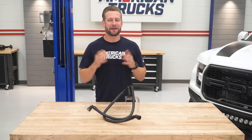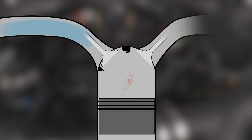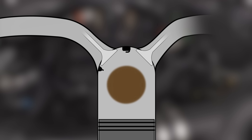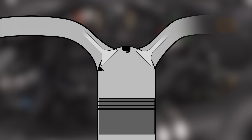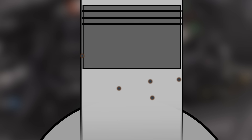First up, let's talk blow-by. This is the result of the combustion event that drives the piston in any internal combustion engine. You've got your gas and your air, which are ignited by your spark plug — they go boom. Most of the remnants of that explosion are pushed out through the exhaust valve as exhaust. However, there is a small amount of this leftover gas mixture that doesn't get expelled and is essentially pulled down past the rings and into the crankcase, hence the term blow-by. This blow-by is typically increased in forced induction applications as those cylinder pressures are increased.